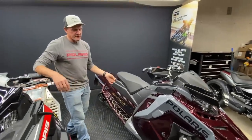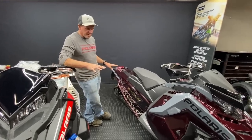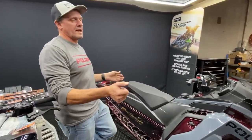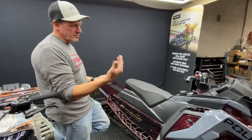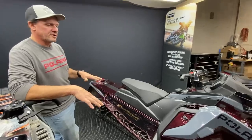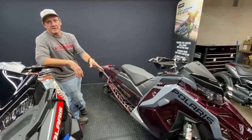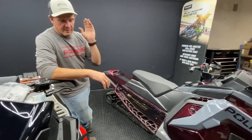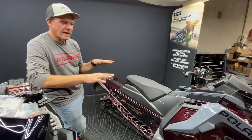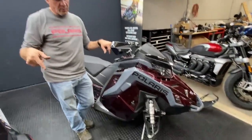When you pick the nose of the sled up even slightly, it takes track off the ground — ever so slightly, but it all makes a difference. You're trying to suspend the snowmobile from three points. If you crank the spring way down you'll pick the nose up too high, put too much weight on the tail, and that tail weight combined with your weight will mess things up. So it's literally small adjustments — a quarter to three-eighths of an inch. Once you have the right springs, the right carbides, and thread it down that amount, go try it and feel those small adjustments plant the skis and help the sled turn.